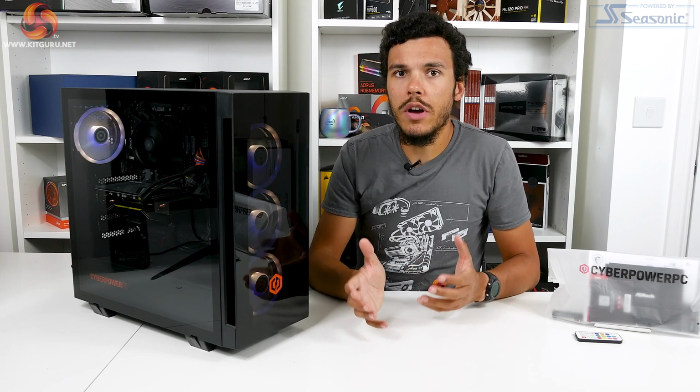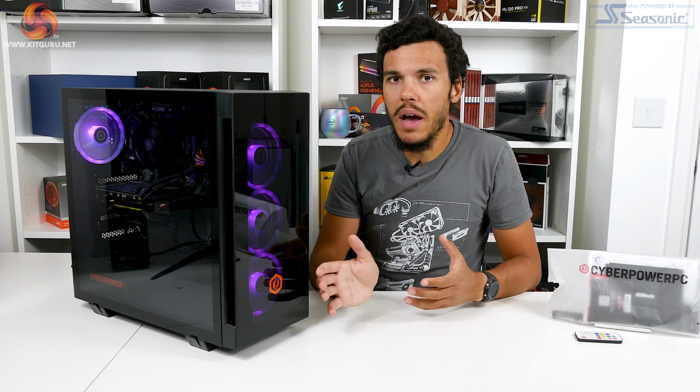While I think the SSD choice is certainly a positive, it could be argued that a few extra pounds for the 512GB version would have been justifiable, but this is a tight squeeze for the budget of the system. Also, you could argue that a bigger, so a 500GB class SSD, but a SATA variant might have been a smarter choice versus the faster but smaller NVMe SSD, but that's up to individual preference. I'm happy with the choice overall.